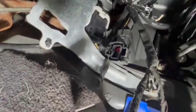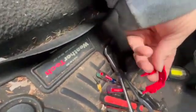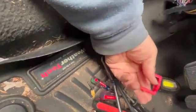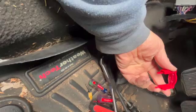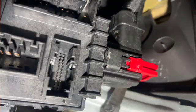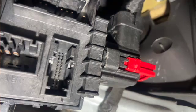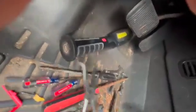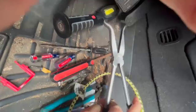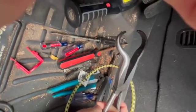That connector right there — where you see the little red — that's the most troublesome connector to get off, at least it was for me. There's a lock on that connector; you kind of squeeze it and it goes up, and then it uncovers a couple tabs that you have to grab. The problem is I'm at such a bad angle being in there, and it's on the back side. The way around it is to use heater hose removal pliers — the points on the end can grab those tabs and push them in, and then the connector comes right off.